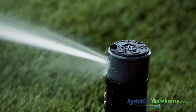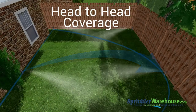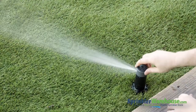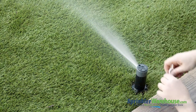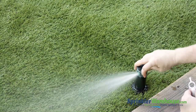See the difference? The nozzle retention screw can be used to adjust your watering distance, also called the radius. You want the stream of water to reach the next rotor over — that's called head-to-head coverage. As you can see, the arc is set to 90 degrees right now. That won't do, so we'll set it to 180 degrees by turning the arc adjustment to point to 180. That's better, but my stop isn't in the right place, so grab the riser and twist.